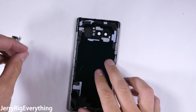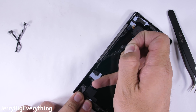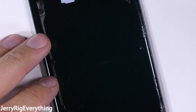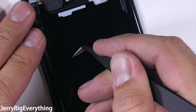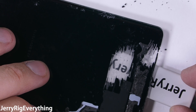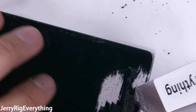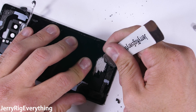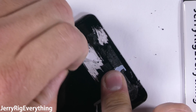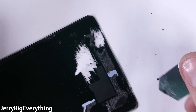Now for the back panel itself. The super strong adhesive that Samsung placed around the outside edge needs to come off. The glass is curved along both sides, and since it's glass I'm being super careful with it. Once all the sticky adhesive is gone I can start removing the color. Using the metal pry tool scrapes off the color but it leaves a slightly cloudy laminate layer underneath, above the glass. This would still look cool — kind of like that frosted effect that older Game Boy Colors had — but I want my phone to end up completely clear.